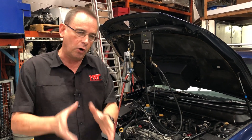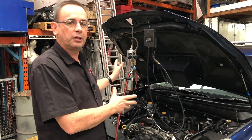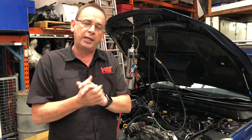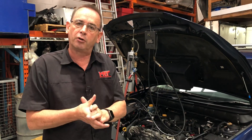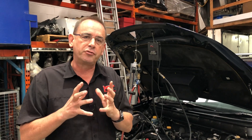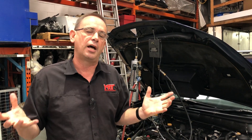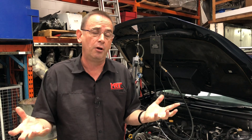The reason I want to talk about this, and why I've got this car sitting here with our soot cleaning equipment on it, is it is becoming more and more common on these models as they get older to have a buildup of soot on the variable vane of the turbo, which then causes a turbo boost control problem, which throws a fault code on the car. You think you may have a faulty turbo when in actual fact you don't need to replace it to repair it — what it needs is to be chemically cleaned.